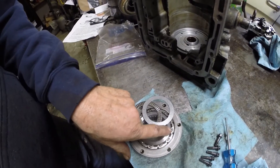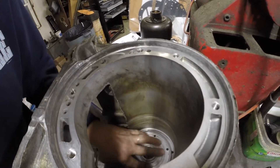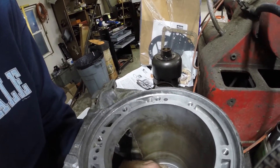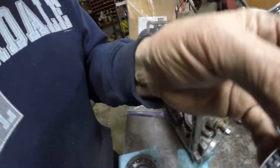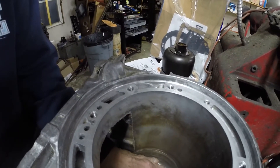You can see it's nice and smooth on this side. We will put some lube on this face and over here for the thrust washer. Now the first thing we put in there was the centering ring that keeps everything centered, then the thrust washer that keeps the wear off the aluminum surface. We lube it up nice so we don't have any problems on startup. Then we come in with the Torrington bearing, lube it up, and lay that in there on top of that thrust washer.